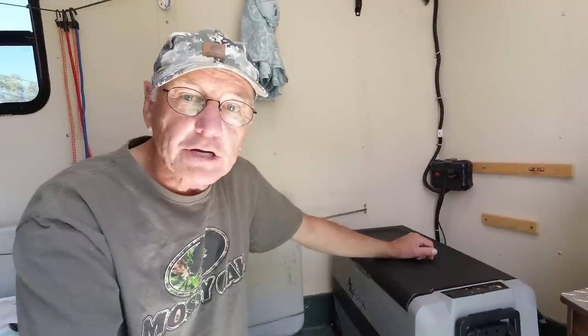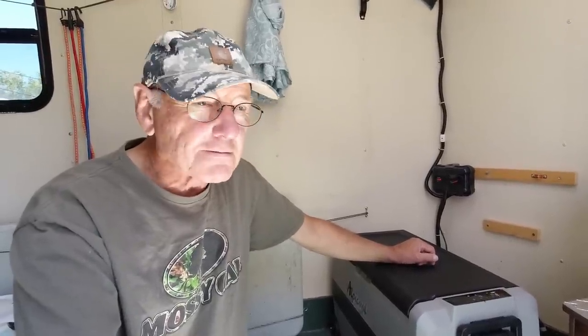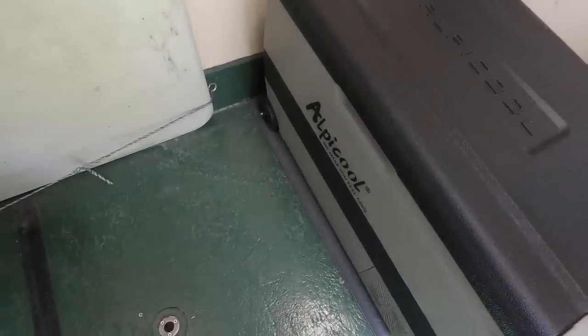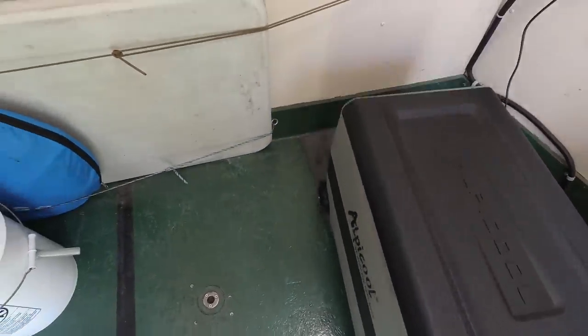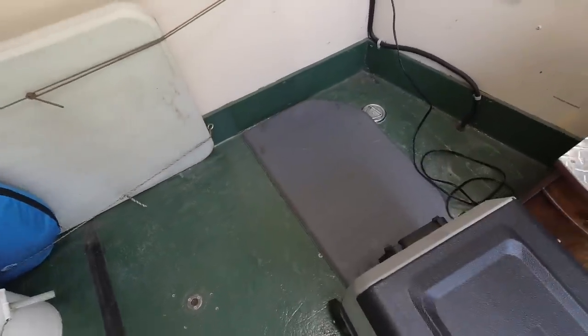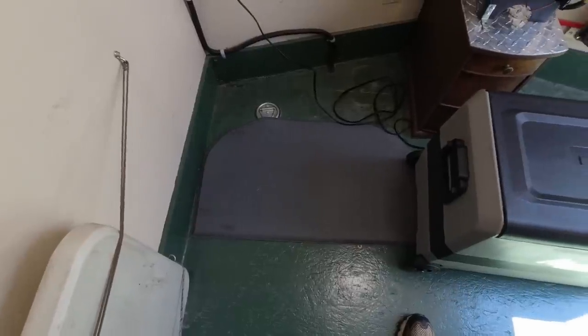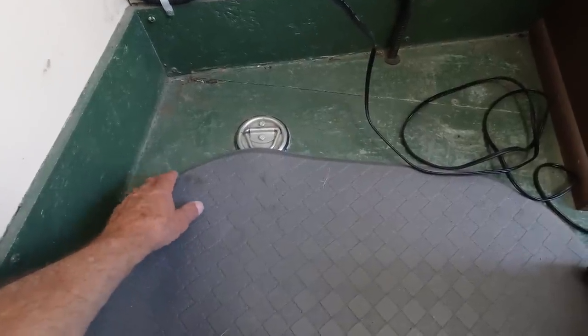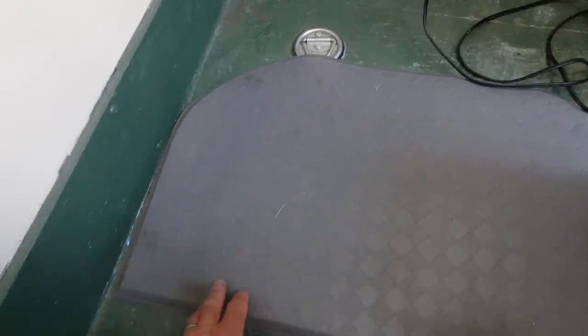The other noise was a loud thump when it was shutting down, and that did bother us. I hate to say this, but I have it sitting on a rubber kitchen mat, and I heard other people complain about the loud thump too. In my case, you can see that the mat's not square and we had one wheel off the back of the mat, so it wasn't sitting even. When it would start up and shut down the compressor, it shakes the cooler a little bit and it was thumping a wheel on the floor. As soon as I moved it so all four wheels were on the mat, that stopped.